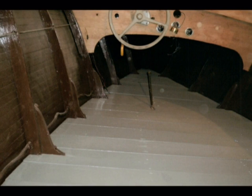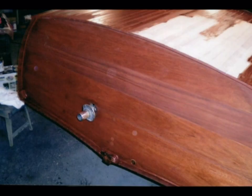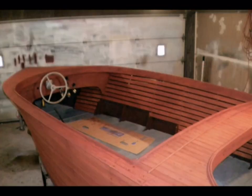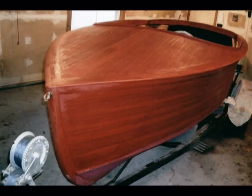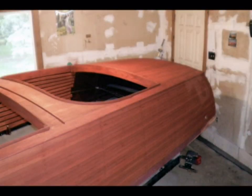Picture of the floor replaced in the boat after priming and painting both sides of the board and painting the bilge. I started staining on the rear of the boat using mahogany stain. I moved from the transom to the interior decks and sides, finishing up at the deck.